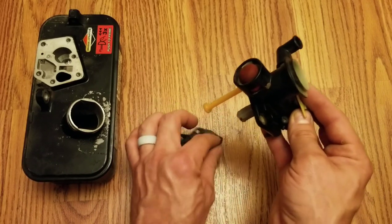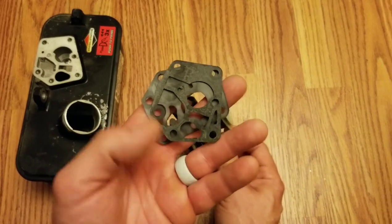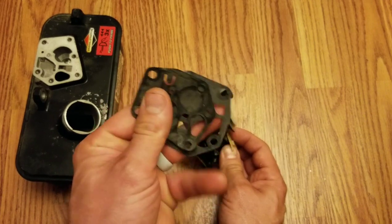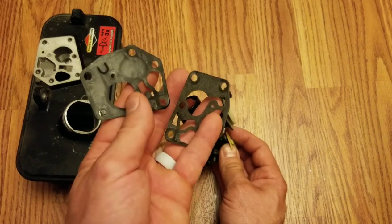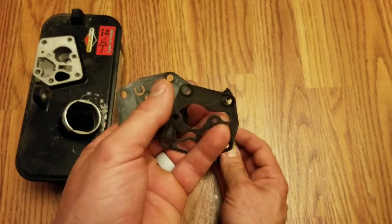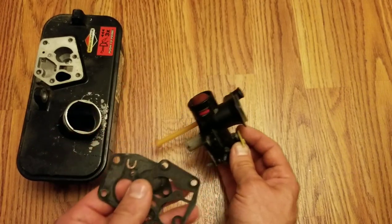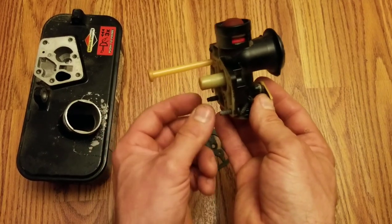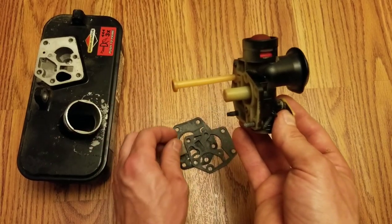Make sure all the residual is removed and you put a brand new gasket and a brand new diaphragm. These two pieces right here are mandatory for the repair to be done correctly — at least this diaphragm needs to be replaced, because it'll get hard and the engine won't run properly. You'll get backfires, and then after the diaphragm gets completely hard it won't run at all. You also have this screen right here — clean that out thoroughly. Remove this spring so you don't lose it.